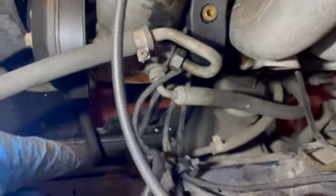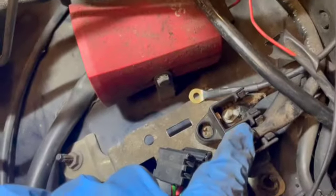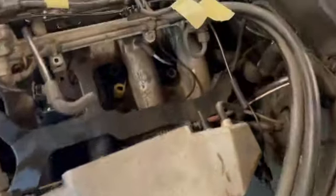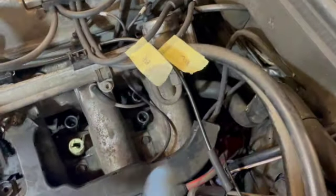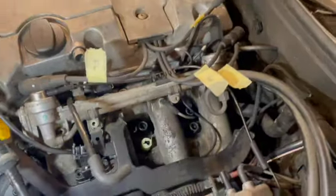right place. And now we're just going to route the earth wire underneath the bracket and out this gap here, through this clip here, and then back into the earth kind of box terminal there. And then we can put everything back together, tighten up the nuts and screws on the plastic tray, put it back together, and then fingers crossed, we're all good.